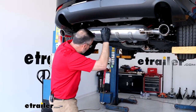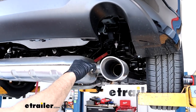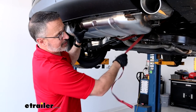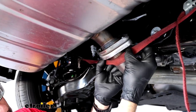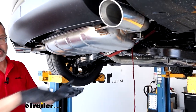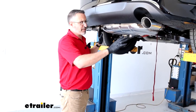Keep an eye on your exhaust system as you bring it down — we only need enough clearance to slide the flanges of the hitch up to the frame. For those working on a driveway, there's one other way to do this: underneath the Mazda you'll see an exhaust flange with two 14-millimeter or 9/16 bolts. You can undo these and take the entire muffler down — it's lightweight — giving you more space to roll your floor jack in. It adds maybe 15 minutes but is totally worth it, especially if you're tight on space.